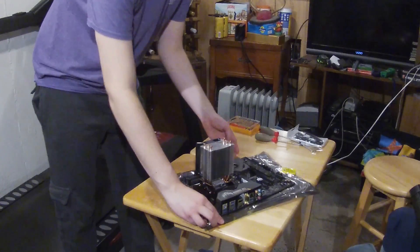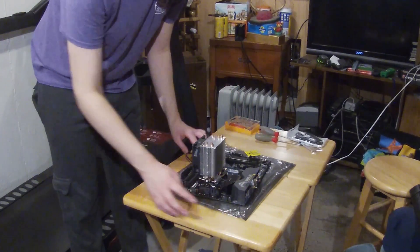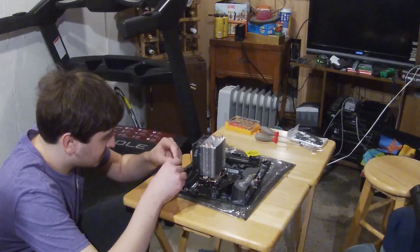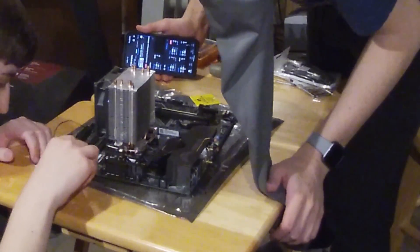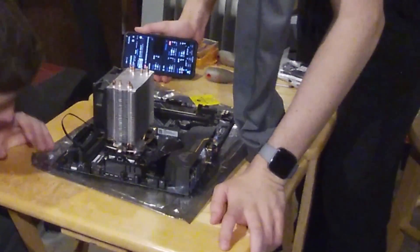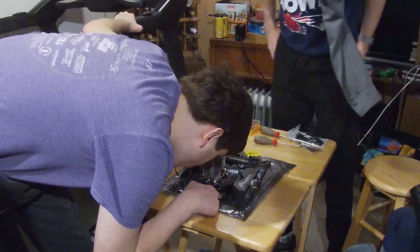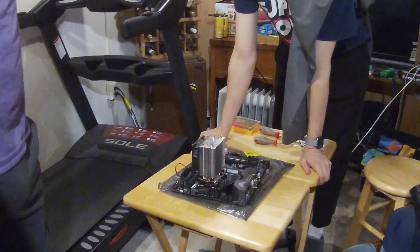Hopefully that's a healthy amount of thermal paste for the CPU. Heat sink has been installed. There was a little bit of doubt about whether this heat sink could actually be installed on this motherboard, but by looking at which side had to go first because of tab size, we got it sorted out. Plugging into what I'm pretty sure is the CPU fan header — there's a CPU fan header and CPU OPT. I think they're just the same thing. There we go. That's the 4-pin connector; the extra little connector is for Ryzen Nines.